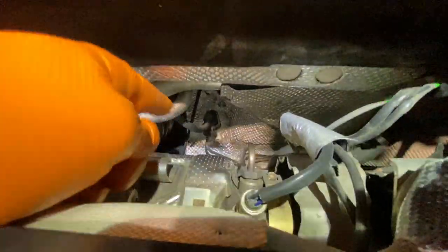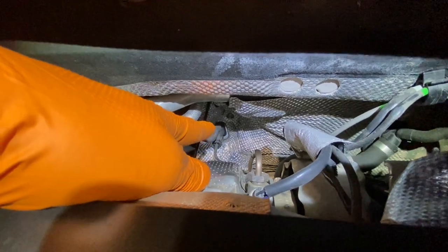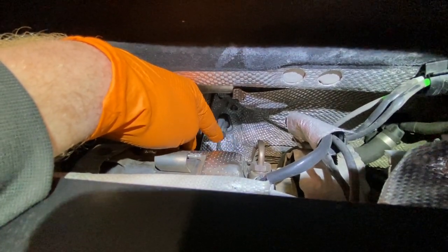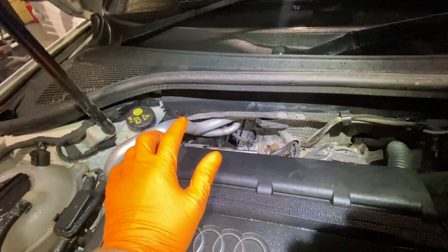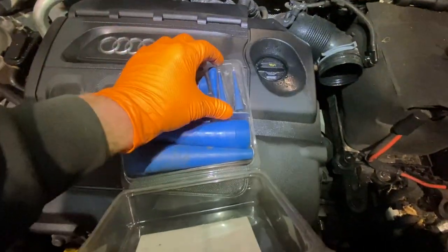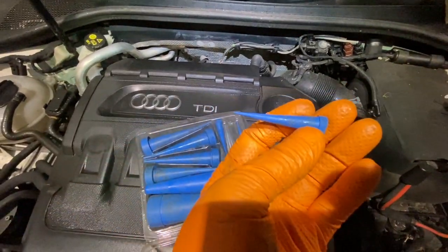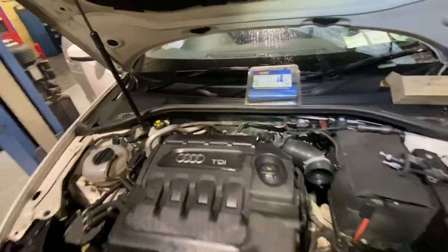Looking down there it's fairly easy. There's a little plastic heat shield held by one or two clips. There's a hydraulic pipe that comes up to the brake reservoir and a steel pipe on the high-pressure side from the master to the gearbox. There's a clip that has to be popped off. We have to pop off this rubber hose from the reservoir. Because it's half full I'm going to pull off the hose and block it. I have a nice little box of plugs — they just pop on and twist into place to block the hole so no fluid leaks while we work.